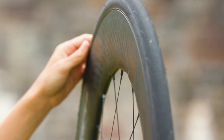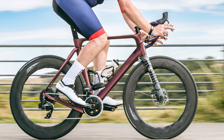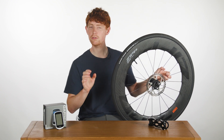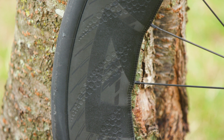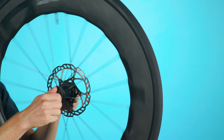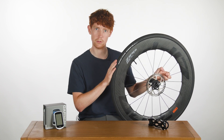But it gains more when you look at the wheel performance as a whole. These elements consist of wind resistance, gravity, rolling resistance and vibration losses. To combat gravity, Zipp have a new rim structure called Carbon Internal Reinforcement — think of it as a skeleton on the inside of the rim, that allows Zipp to reduce the amount of material by putting strength where it's needed and removing excess material where it's not. The result is a weight reduction of 282g over the old model.